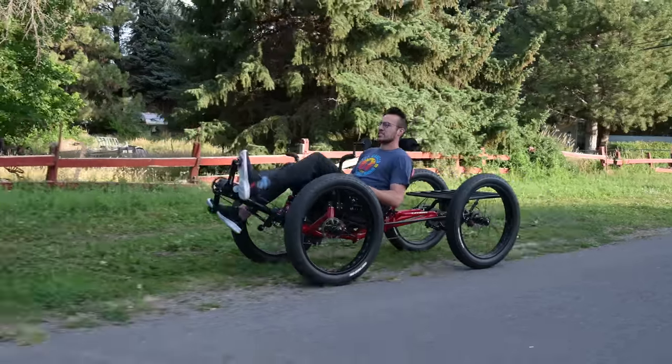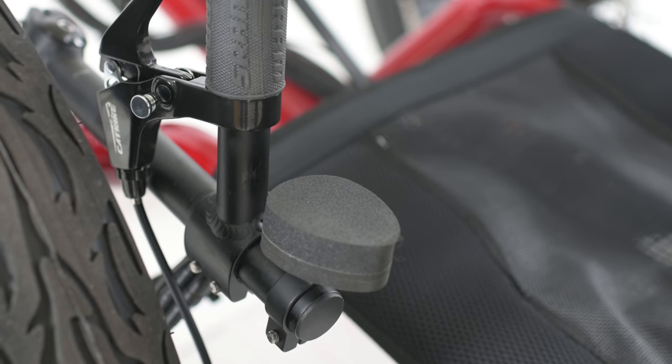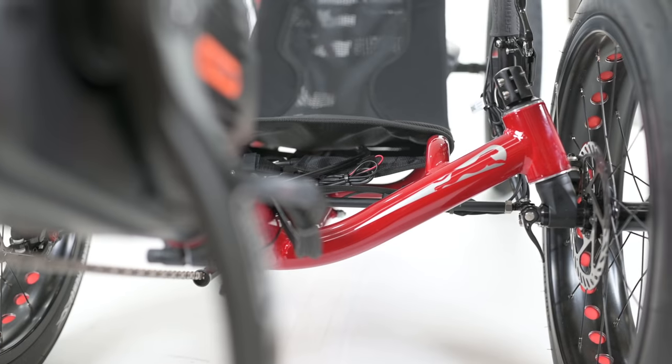Our first Fat Cat 4 Quad was built using the CatTrike Villager as a platform. We've also built a few quads using the full-suspension CatTrike Dumont. The quad we're looking at today is built off of the CatTrike Expedition, one of our top-selling trikes. The Expedition uses CatTrike's space-frame design and has a seat angle of 37 degrees. It comes stock with a headrest, locking brake levers, a rear-view mirror, CatTrike wrist rests, and powerful Avid BB7 disc brakes. This quad uses direct steering and CatTrike's impressive steering geometry makes for a sporty, responsive ride that handles well at high speeds.